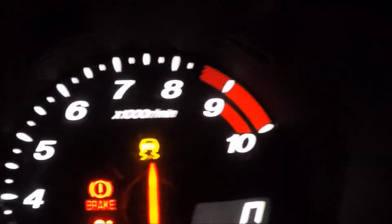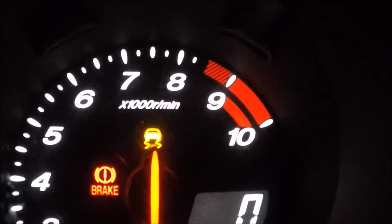You just have to short shift, which by that I'm guessing they mean lower RPMs. But if you look, this thing redlines at 9,000 RPMs. That's a lot. So they say to short shift about 4,000. The Speed 3 I had, when I'd be racing, or like driving fast, taking off, I'd shift about 4,500 to 5,000. That was high for that car. This, they say short shift at 4,000. But once it reaches 170 degrees, then you can drive it to 9,000.